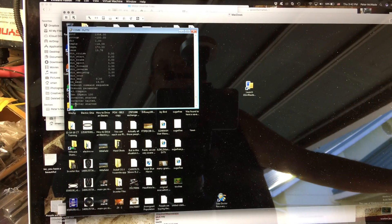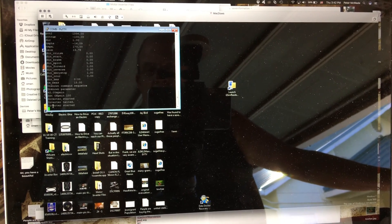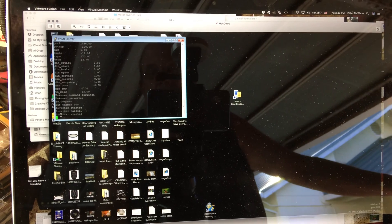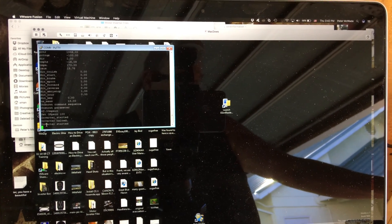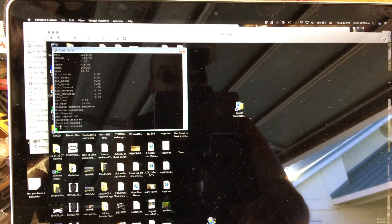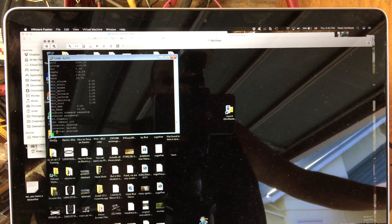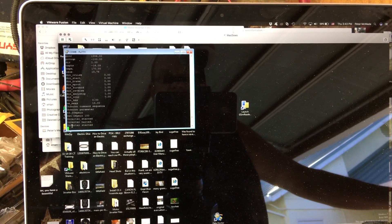In start one mode, if I'm in the web interface on my Mac and I change the parameter to one, I can do it, but it doesn't automatically start the inverter, so it doesn't work. I don't have a key switch - just the way I have everything set up it requires that. But that way I can still use my throttle to test. I can change parameters and upload firmware using the other setup, but just to get it to run I have to use PuTTY.